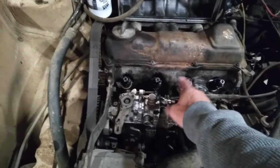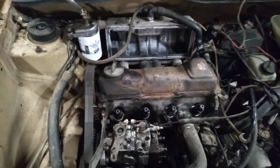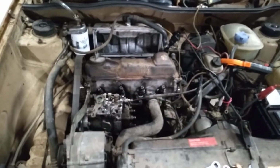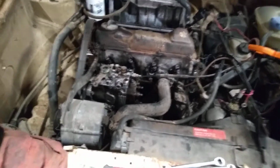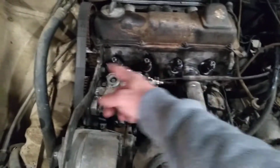All of my little overfill, well, they're drains. There's drains on each of the injectors. Anyway, all those lines leak, so it leaked everywhere, and this line was just a mess of diesel leaking everywhere. But I tried to run it and bled all the lines. Made sure there was fuel coming out of all the injector ports and bled all the lines.